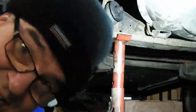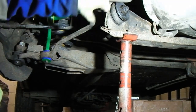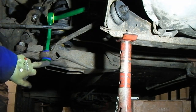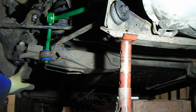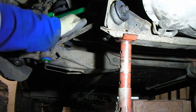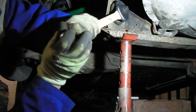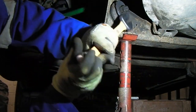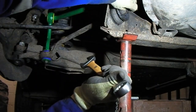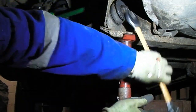So what we're undoing to get this rod out - that one up there is 27mm. We've got 17mm at the bottom of the drop link, and there are three more 17mm bolts - socket sizes obviously - to allow the radius arm to come off the radius rod. I've been soaking this probably since the MOT, which was Bus Fest, so months of soaking. If you've got the patience, it will work.